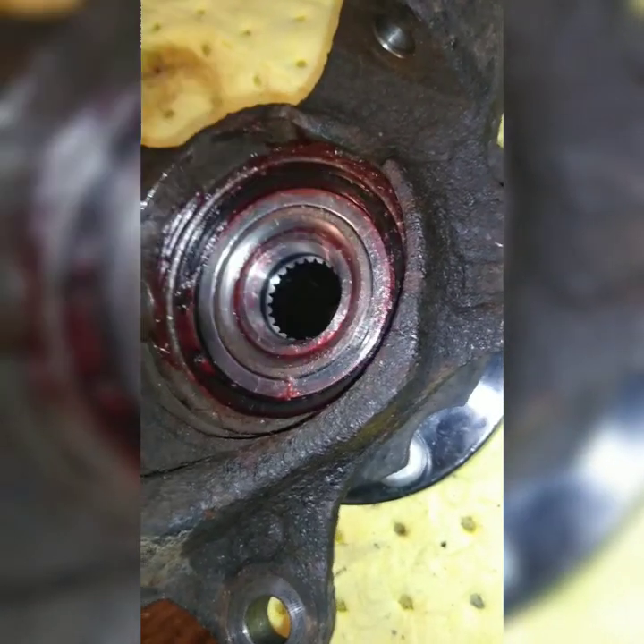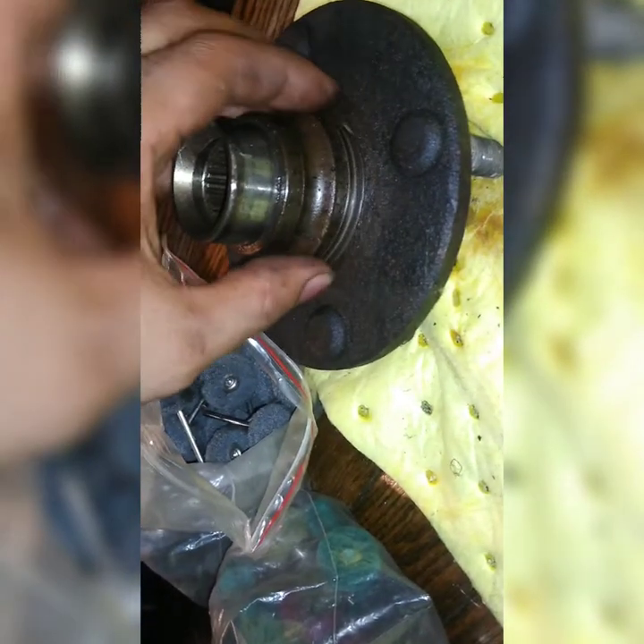Push down on the hub — the hub has a little heel, and while you're pushing down you'll know when to stop because it just stops going in. I'm done with my bearing. It's perfect — no wobble, nothing. It has my new snap ring and it's ready to install.